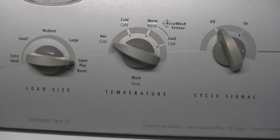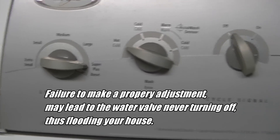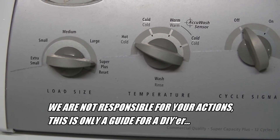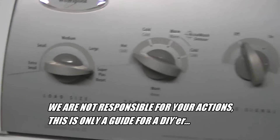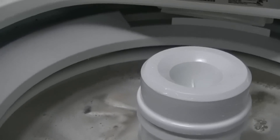Before you start filling it up, make sure your air hose isn't pinched. You can disconnect it from the switch and blow air into it to make sure it's clear down there — just don't do that while you're actually filling because you'll lose the air out of the cup below. As you can see, it started up just fine. We've got the water level we want, and that was with clothes in it — so you can see it's just a little bit different than when we adjusted it without clothes.